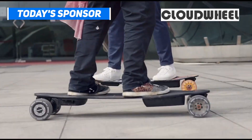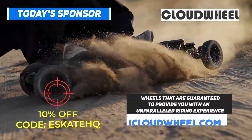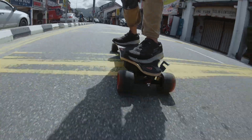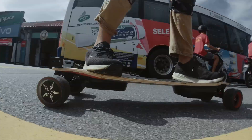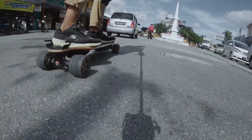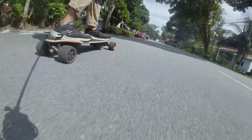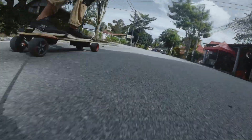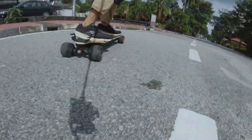If you're allergic to road vibrations, there's always the option to spend extra and upgrade to bigger 125mm Cloud Wheels Donuts. Cloud Wheels are now available not only for belt and hub boards — there's even a 165mm all-terrain version. You can check it out via the link in the description. Meepo's 45-degree shredder trucks are biased toward stability, while 50-degree trucks like the Poseidon trucks on the WowGo 2S Max are more carvy. The shredder trucks don't rise to the level of branded trucks like Caliber 2 or Paris, but they're just as good as other proprietary trucks on affordable e-skates — decent for carving, good return to center, and absolutely stable at top speed.